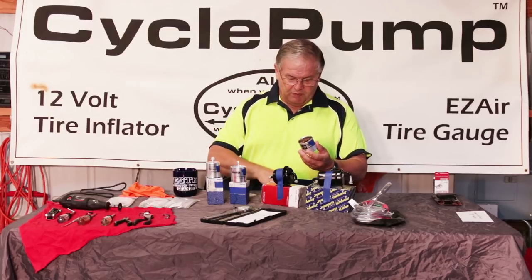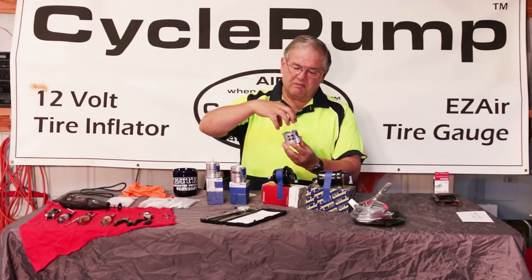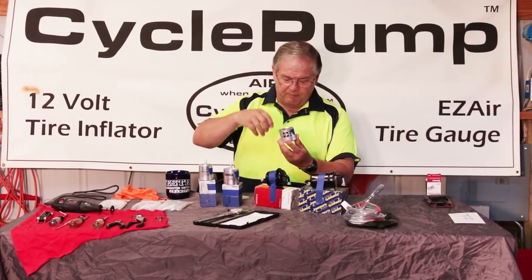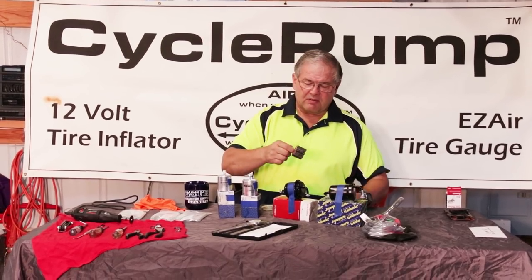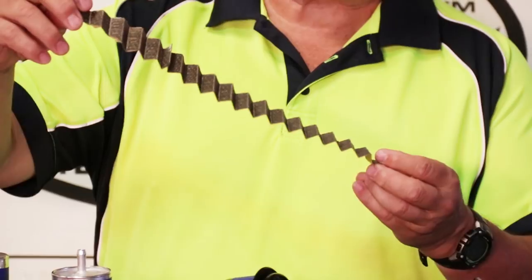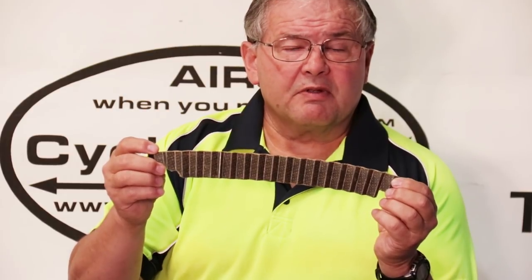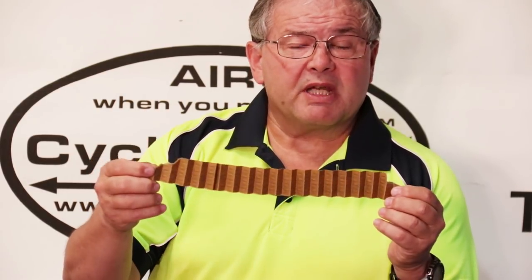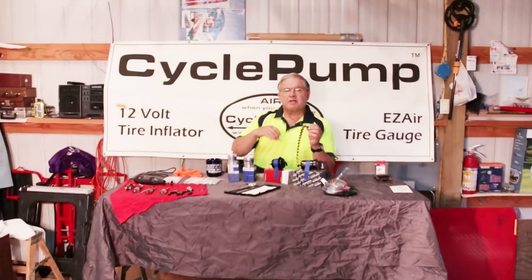What we're going to be replacing is this canister cartridge, which I've cut apart using the cutoff wheel. It's a filter element that sits down inside, wrapped with plastic end caps, and around those end caps there's an accordion filter. What you're seeing now is a black surface — when this was new it was white. In 10 years of riding, this filter strained out all this black gunk from the fuel. We're trying to filter out anything we can before it gets to our injectors.